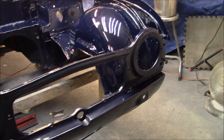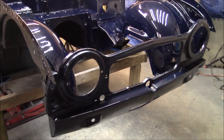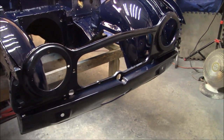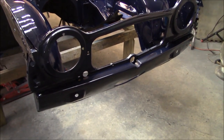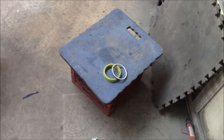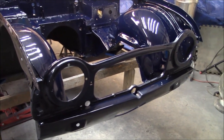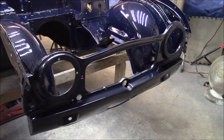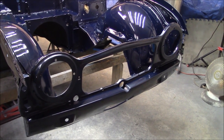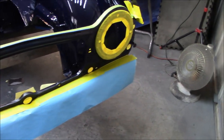In order to move on to the next step, I want to do that before I put it back on the chassis — it'll be a little easier to do it now than later. I've got a couple rolls of tape out, a little fine line tape and some other tape, and we're just going to mask off the areas we don't want to get the flat black on. We'll come back and show it to you masked up before we spray it.